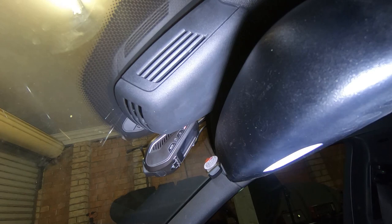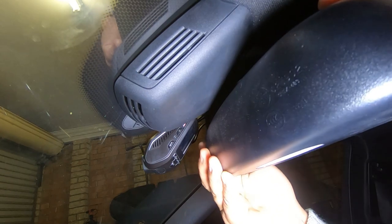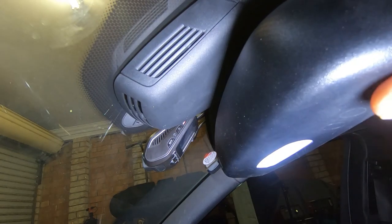I'm going to show you just how I remove the light slash rain sensor for the W204. In order to give yourself a little bit more room, if normally your mirror is folded in, make sure you bend it just a little bit away or straighten it up completely to give yourself more room.